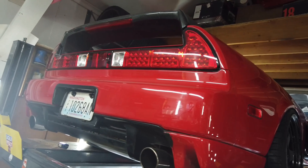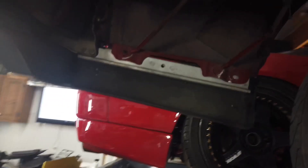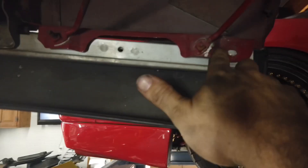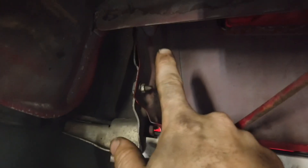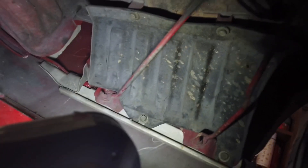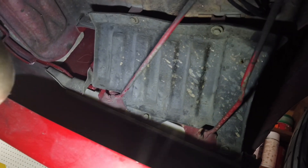I opened up the trunk, pulled back the carpet, and undid the two bumper bolts. On this car there is a little splash shield here - it's bolted in four places. I need to take off this 10 mil bolt, there's one above it you can't really see, and the exact same thing on the passenger side. Taking off that splash guard will allow me to get to the two bolts behind it, and if I do that on both sides the bumper should come right down.